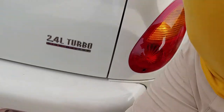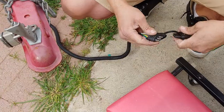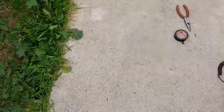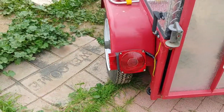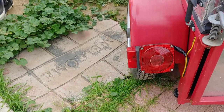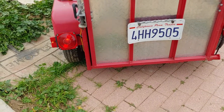Now with regards to that, let's test for now. My left and stop and all that — I'm going to test that with the trailer. I'll wire up the right side after the video. Let's go ahead and connect that in — there it is — and then we're going to walk over to the back of the trailer and just look at those lights. You should have running lights now in the back of the trailer. You got to get that white ground on, otherwise it's not going to work.